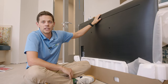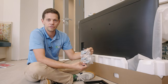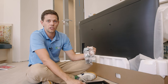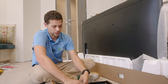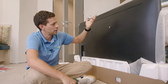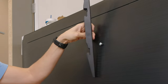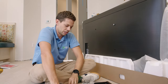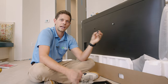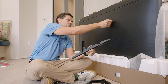We've already started unboxing the television and pulled the mount box open. There are different size screws in these mounts and you've got to find the ones that work for your TV. There's a specific diameter for your TV size and a length that will work. Start grabbing screws, threading them in, and see if they actually thread. If you find ones that thread, look at the length — if you screw it all the way in and there's still a gap, that void might be too much and you may need to use one of the little spacers.